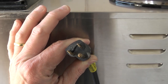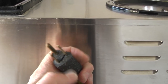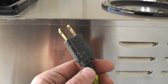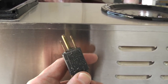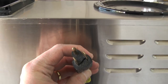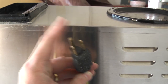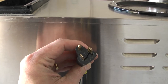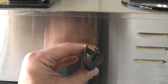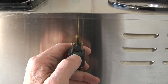My first suspicion is that this thing is very charred, or it's the outlet here that is actually starting to short, which may trip the breaker, or something internal. My suspicion at this time is that replacing just this cord here will do the work. But I actually ended up opening it up just to see what the internals are and the overall status of the machine. I'm suspecting that this outlet is the culprit of all the problems — it's really in bad shape.